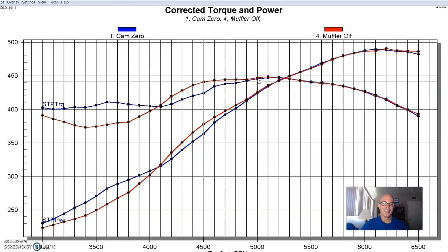Make sure you have the right collector length extension — it definitely has an effect on power. If you're judging your 60-foot time, your launch, and your converter, missing 30 or 40 foot-pounds of torque in that RPM range is going to have a decided effect. It would be cool to have an extension that shortens in itself like a sliding tube, so you can have the right length from 3000 to 4000 RPM and then make it shorter from 4000 to 5000 RPM. We've done this test on Fords, Chevys, Dodges and almost everything, and this is what we consistently see.